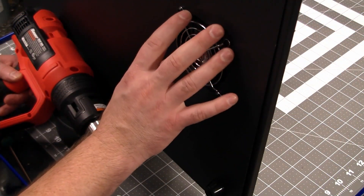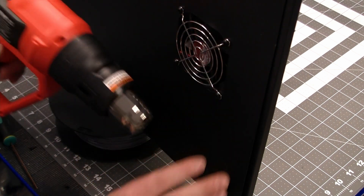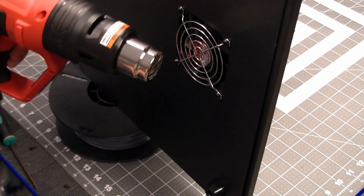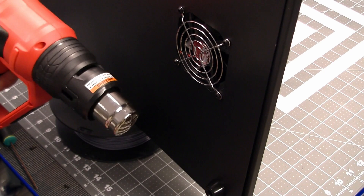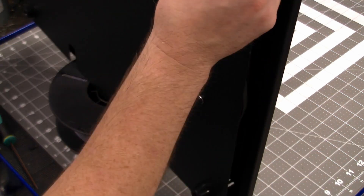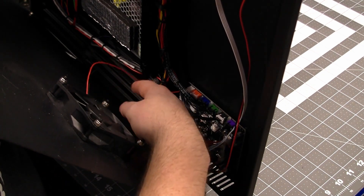The factory hot glued all the connections inside the printer. The easiest way to get them off is to heat them up with a heat gun or a blow dryer on low heat until the glue is just soft enough to disconnect the connector. This should only take five or ten seconds of heating. Find the wire going from the fan to the mainboard.